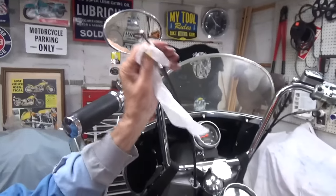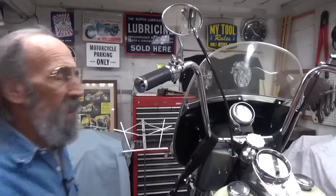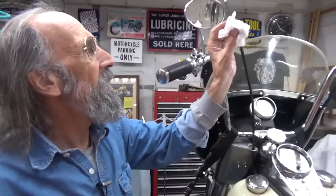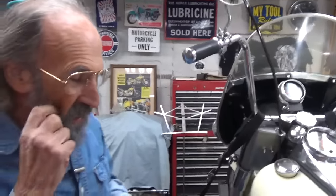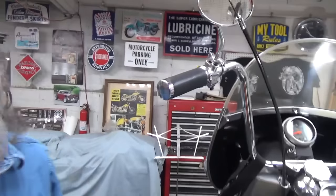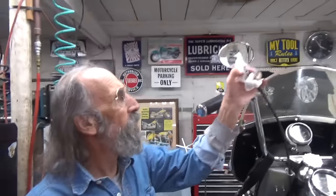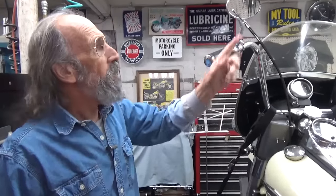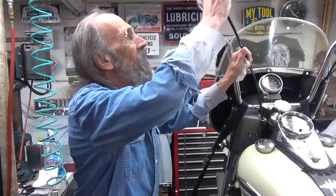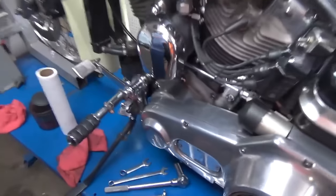Now we push the cable down and that takes it right in there — it gets in there. We're adjusting a clutch on a shovelhead; it's pretty much the same on an Evo, except that all the later Evos don't have a clutch arm on them, and we're going to go over to that arm in a minute. If we had time we'd use that plastic sandwich bag with a rubber band, fill it up and hang it straight up. I usually hang them on the wall and keep pumping that stuff through them — it'll sit all night and gravity makes it run down. Once it hits this big curve here, you'll notice there aren't any serious bends in this thing. I try to keep them really nice and sweeping.